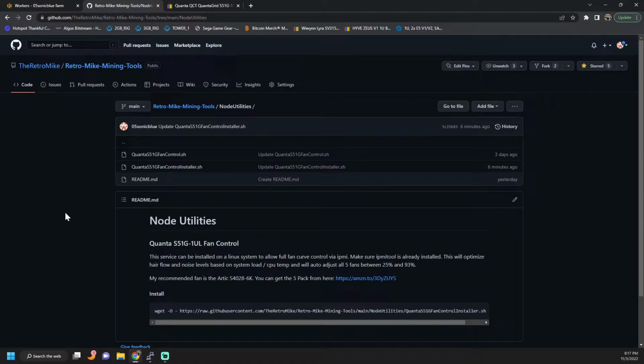I run the Arctic S4028 6Ks, which are the 6,000 RPM fans. I'll link those down in the description as well. And with those fans with this server, it is pretty quiet. Even at full throttle, it's pretty quiet, but you don't necessarily need to be running them full speed all the time. So this service will take care of that for you. It will basically ramp them up to 93% when it needs to, and it will step them down all the way down to 25% based on CPU temp.